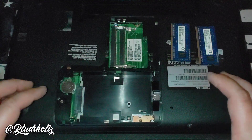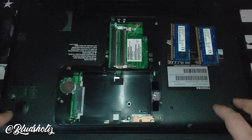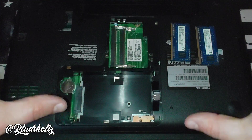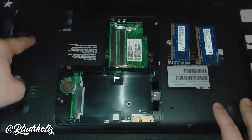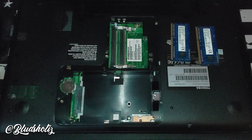If you want to take out the rest, there are screws all the way around here — ten screws around the outside. You'll pop this bottom plate off and you can clean the fans out. I have a fan here and over here on the motherboard — I want to clean that up. But that's it as far as replacing.